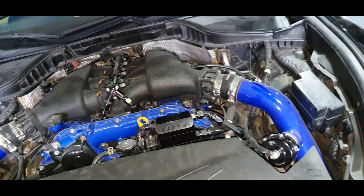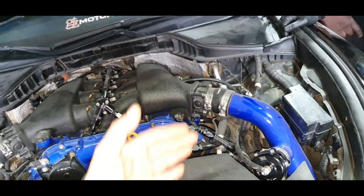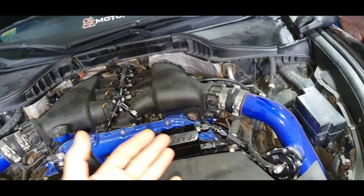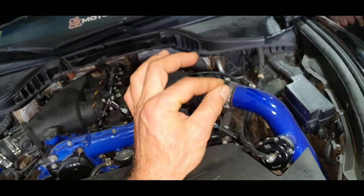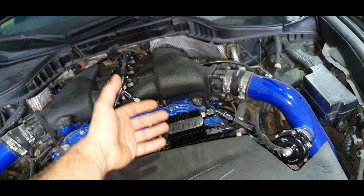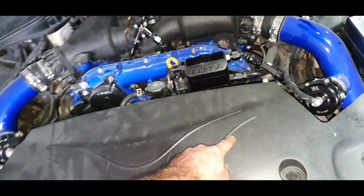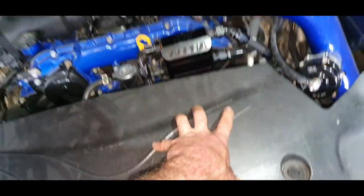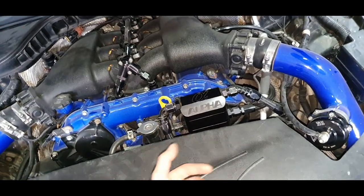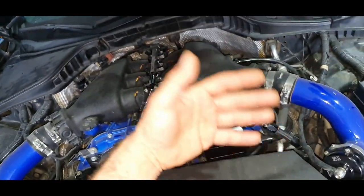So what are we ending up with? Either you're going to put thinner clutches, which is exactly difficult, because you have to find the correct size, and we're talking about a hundredth of a millimeter, tenths of a millimeter in the worst case scenario, because the stroke is small, it's a short stroke. Or you can remove the pad from the flywheel, because it has a stainless steel pad, the billet flywheel. And you can machine under this pad, or you can machine, let us say, the pressure plate. The easiest one is to remove material from the flywheel behind the pad, because the pad is hardened, much harder, so it's very difficult to machine.